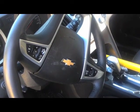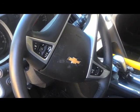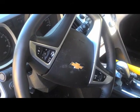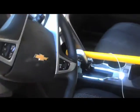Now the next thing you're going to want to do is take the airbag off. It's a little bit tricky, but I've got this other steering wheel that I'll show you how to do it on. You're going to want to rotate your steering wheel almost all the way to the left — you see how it's sitting right there — and I'll show you the reason why.